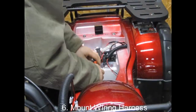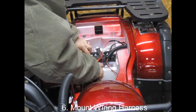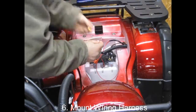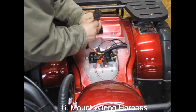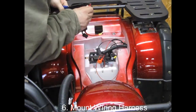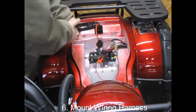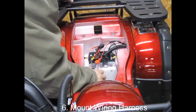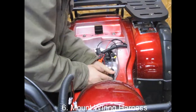A Phillips screwdriver is all you need to disconnect the studs on the battery posts — you're going to put your own terminals on here. Make sure they're the right size before you get them all crimped on. Attach your fuse holder to the positive side of the battery, make sure those connections are crimped solid. Put as small a fuse as you can in there — TrailTech recommends 1 amp, though a 5 amp will do as well. Attach your black wire to your negative post and you are all set.